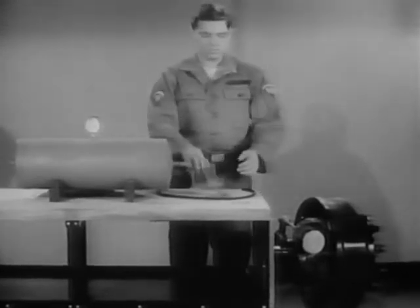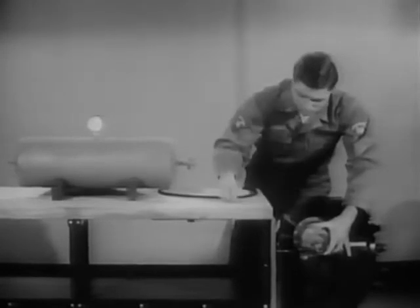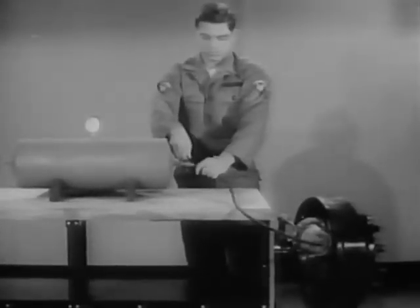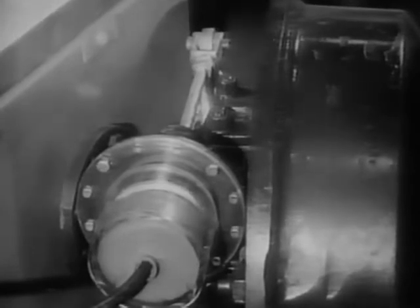How can this force be put to work? Let's insert a heavy rubber balloon into this plastic container and attach it to the wheel braking mechanism. What we're going to do is blow up the balloon so that we can actually see the air pressure — the balloon — pressing against the linkage. We will get our pressure from the air tank, which is simulating the reservoir on large vehicles.